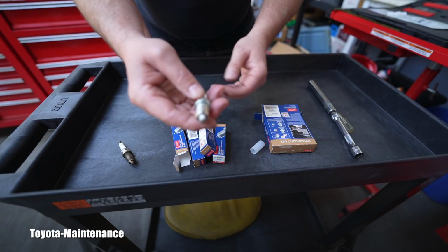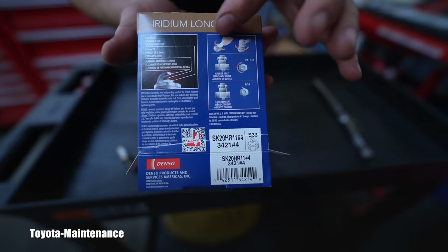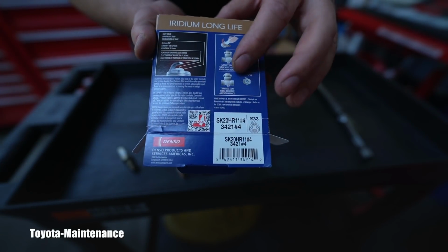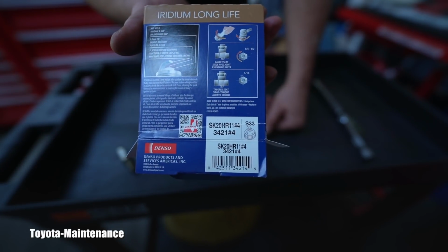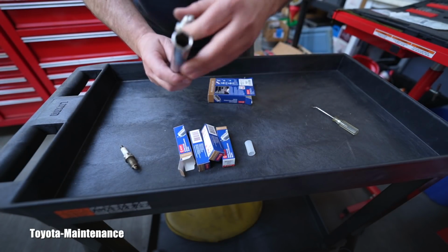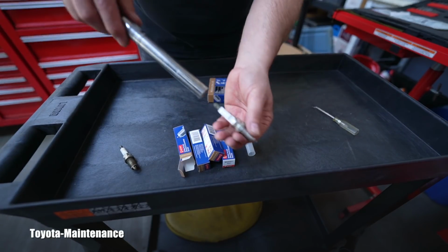We know this belongs in this engine, and we are going to install the first one right now. And how you torque it, basically these are pictures with a minimum of writing. It says you put it in by hand only, and when it stops you continue 1/4 or a maximum of 1/2 of a turn, and that's how it will be correctly seated in the engine. If you do it the first time, you need the spark plug socket, because it includes inside a rubber ring which holds the spark plug, so when you put it in the engine it doesn't fall out.